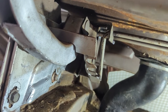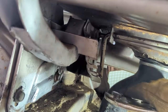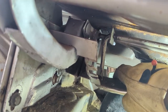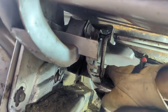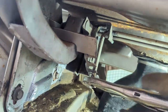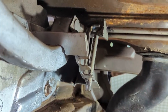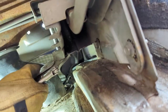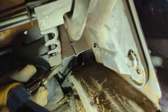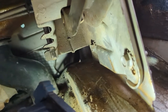You pull down the rod for the right side on the left side — the rods cross over. What the 1965 repair manual says: put a pair of vice grips on the bottom and pull with all your might. I'm just going to go to the first notch — watch your fingers. That's on the first notch. Then go to the other side: yank it out, flip it up over, and hook it in that first notch. That is how the book says to do it.